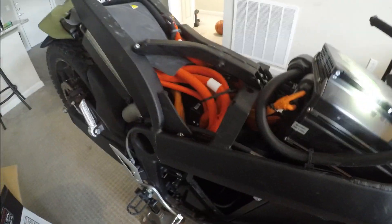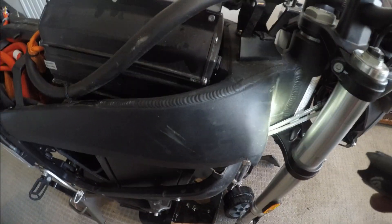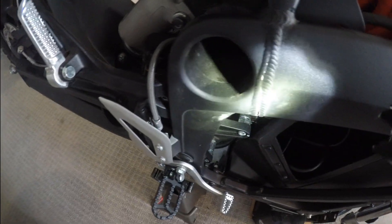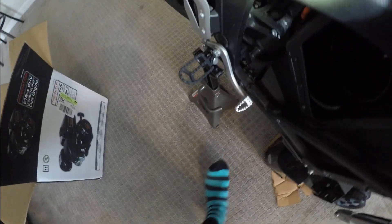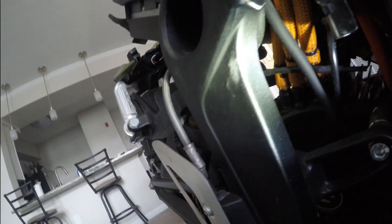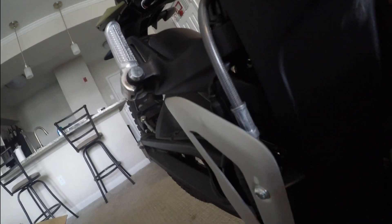The brake lines will need to move and then he should be able to start welding. And then the last crack here — close up — it's right on the frame. The wires behind it are far enough away; there are no wires in close proximity to that. I can probably shield that with something non-flammable to protect it a little bit. He can get around that with a little bit of TIG and just get that crack sealed. Yeah, just looking at the crack up close.